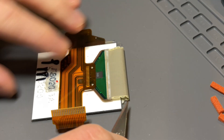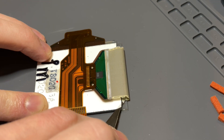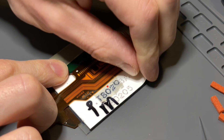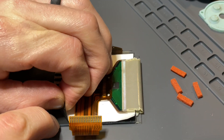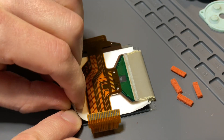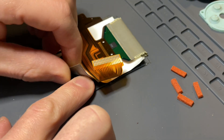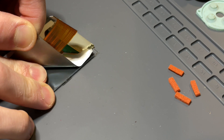On to the polarizer film. Be very careful during this step when removing the back polarizer film, as the ribbon cables above are really fragile. Using a craft knife, you can gently slide it underneath one of the four corners. You want to expose the corner just enough to grab it with your fingers and pull it up and off. The adhesive is quite strong so you have to use some force — just be careful not to let your craft knife or your fingers slip. I used a craft knife on multiple corners because the first corner only peeled back the white film layer and not the polarizer film underneath. Once you get it off a bit, you can use a spudger to get in deeper and work the film off of that adhesive.